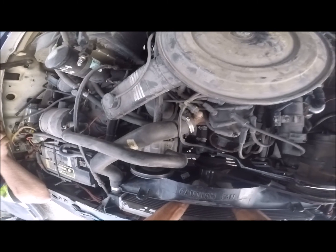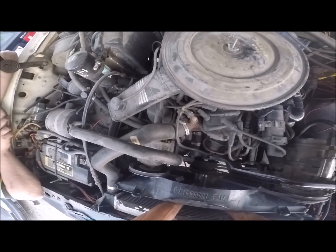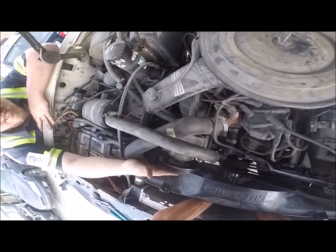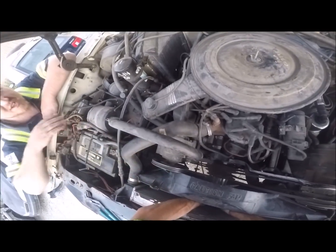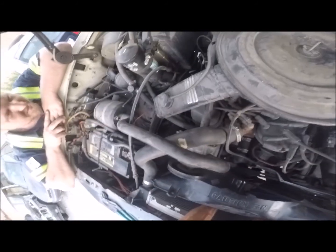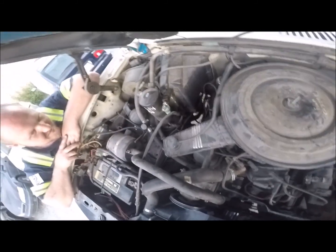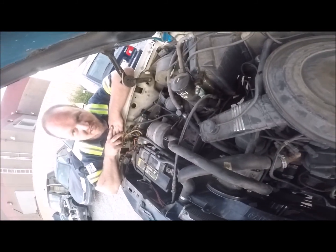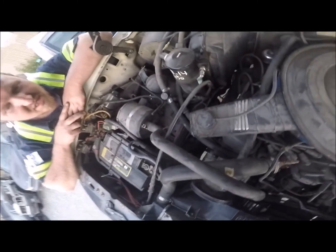Right, your distributor. Yep. Or your distributor air cleaner. Pump or no, it's straight down in front of me. That's an air pump. That's for smog. Oh, the smog pump. Yeah, air pump, smog pump, it's all the same. Technical name is air pump. It just makes air and then shoots it in the back of the heads to help airflow. It's almost like compressing air and throwing it in there, but it's doing it to push the exhaust gases through and burn a little cleaner.